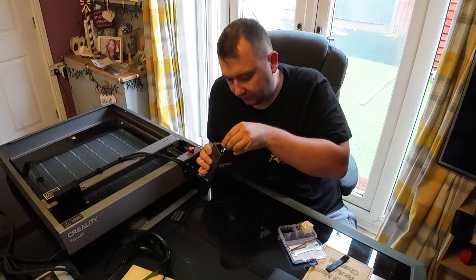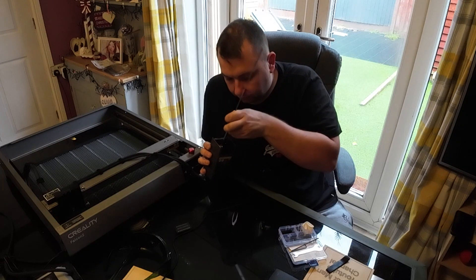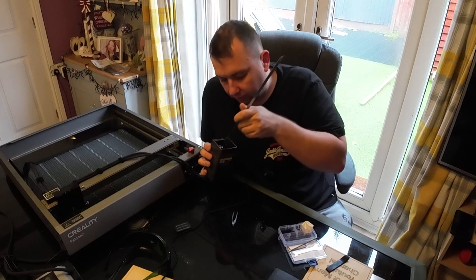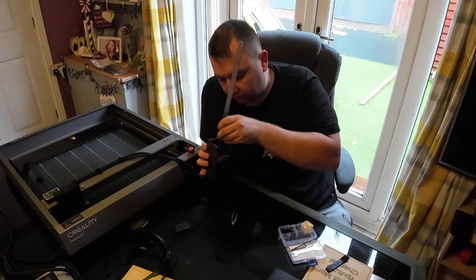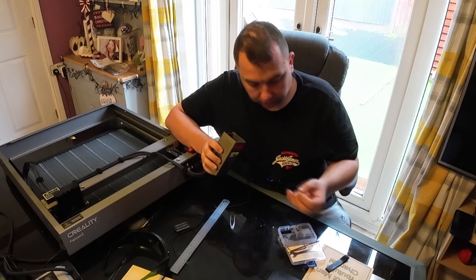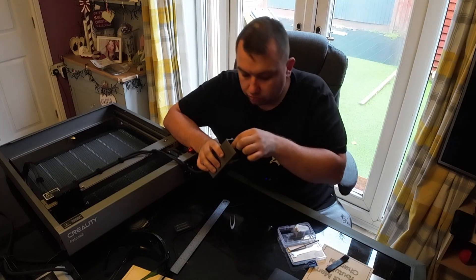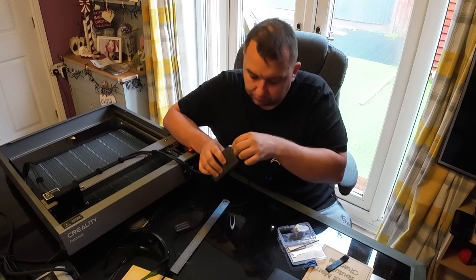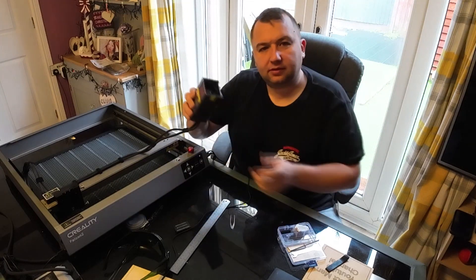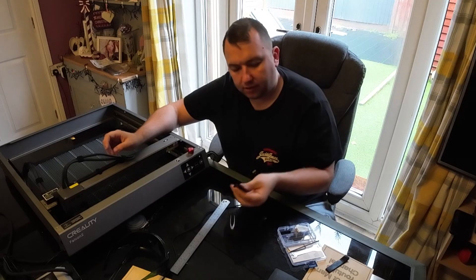Get your brass ring - it can only go in one way because the slots are only on one side. Sit it in and you can start it off with your fingers but do not push in because you'll touch the lens. Then spin it on - it is a bit fiddly, I'm not going to lie. I think this ruler will fit in the slots nicely, better than the tweezers. Just make sure whatever you use doesn't scratch the lens - that's the main concern. That's the lens back in. Give it a little blow - you do get a cloth in there to wipe the lens too.